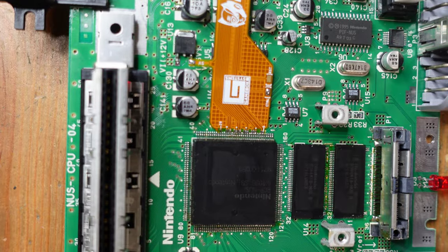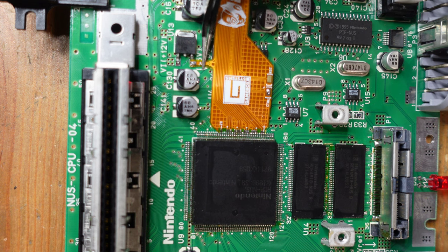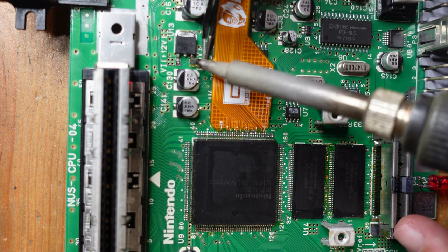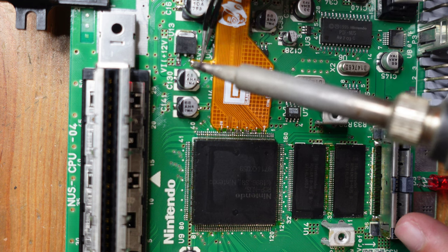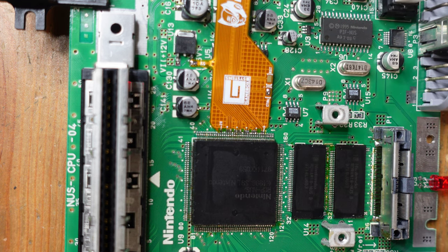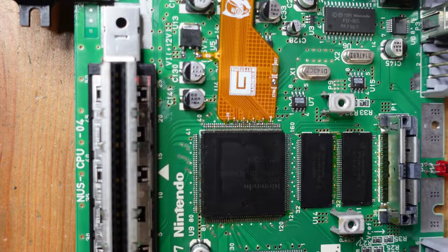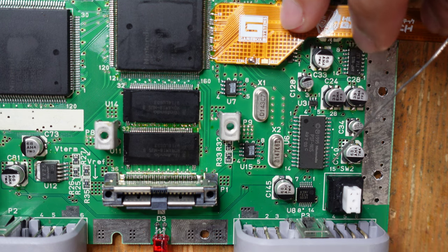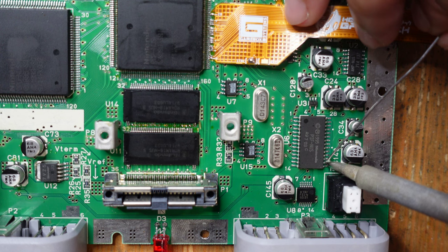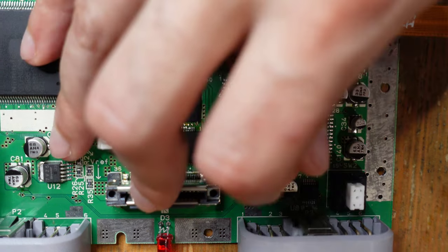All right, so I went over all of the connections on the flex and they were actually pretty good on the first pass. I just did a little bit of touch-up under the microscope, made sure there's enough solder on all the points and cleaned it all up, and now everything is looking good. We've only got two more things to do as far as soldering goes. The first is right over here — we're going to solder this little pad to this transistor right here, which is what provides the mod 5 volts so that it can be powered up properly. And then the final thing we need to do is solder a wire to the PIF chip. This is the older Rev 4 version of the N64, so in order to solder to the control pad it's actually pin 16, which is right over here. If you have a newer revision of the N64 motherboard like a Rev 8 or 9, it's a different location and they show this in the installation guide. In my case I'm going to be soldering this one wire here to pin 16.